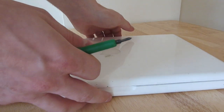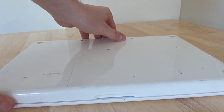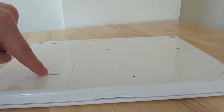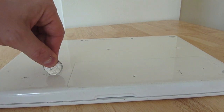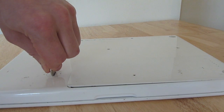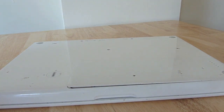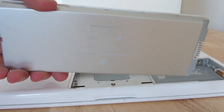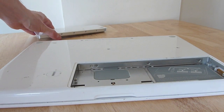What we have to do is just turn the laptop upside down. We have the battery compartment here and the slot in which we insert the coin and turn a quarter turn clockwise. You can see the battery has become separated — we just lift that out. That's the battery there. Put that to one side.